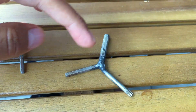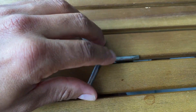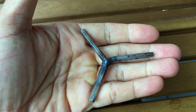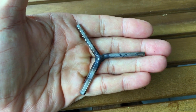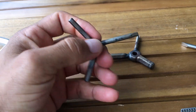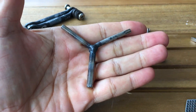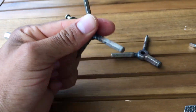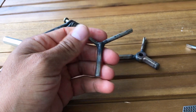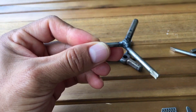Why I'm going to put these three together? Because these are the ones I needed the most torque. Normally with this size I can reach seven Newton meters. So you have to make sure that you will be able to tighten the bolt to the according Newton meters. Handlebar stem, I believe drive chain — I will be able to do it with this size.